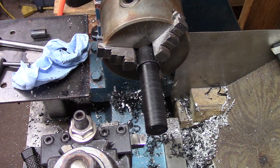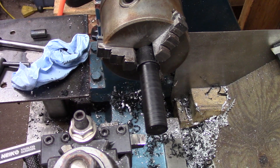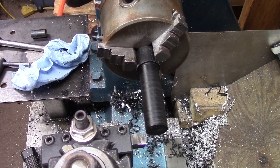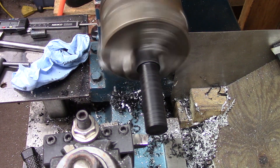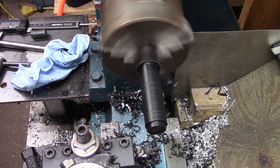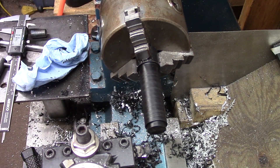I'm just going to get a touch off. My little DRO on the side of the slide here is not working at the moment — probably needs to be replaced. So I'm going to use the end of my digital calipers. We're at 21.5, so I'm going to move in two millimeters to begin with — that should be four in total removed. Let's take a cut there and see what that's coming out as. It's about 18, that's what it should be. Let's go ahead and cut that, then we'll come back and do the other.